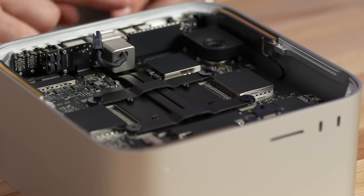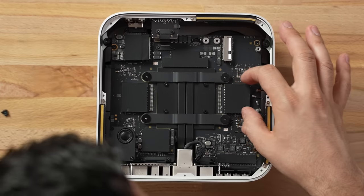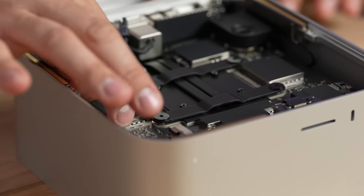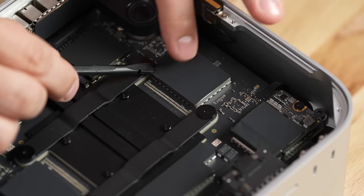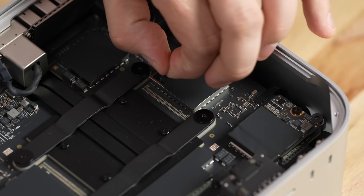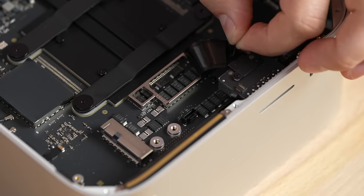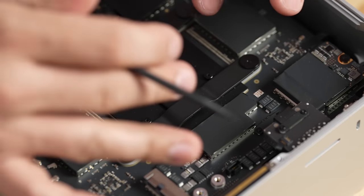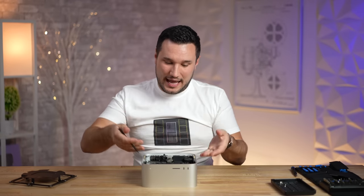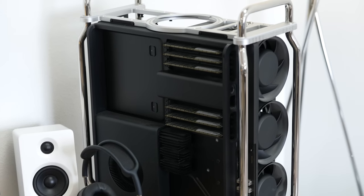Wow, this whole thing just lifts up — that's the bottom cover and power supply, all aluminum, no flex. Is that the M1 Ultra chip right there? You've got heat pipes wrapping around, the holder and screws to lift it up. What's on the outside — controllers, or could that be RAM? Let's just take the stickers off. That looks like a power controller, and there are more chips here — everything is underneath this heat pipe and cooler, which nicely means the RAM is cooled alongside the CPU and GPU.